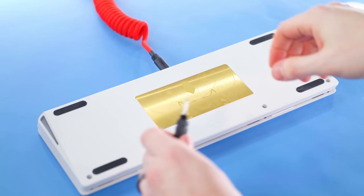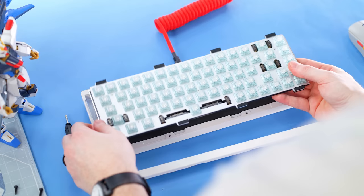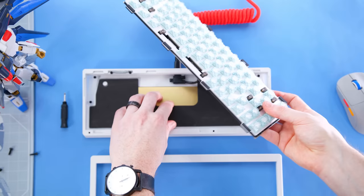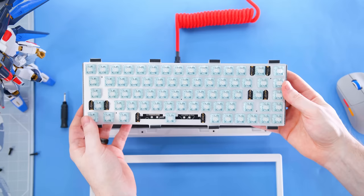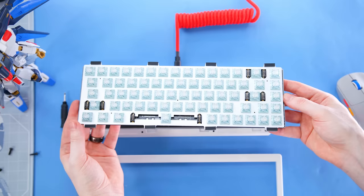This is by far the easiest and most mod-accessible keyboard I've ever seen, because typically there are bottom screws and screws in the top plate to hold it down — but Highground's got it figured out here. Once the top frame is removed, the plate and PCB can be lifted up, and you'll see it's gasket-mounted with rubber strips around the outside of the PCB. This is what gets sandwiched between the frame and board to give it that free-floating design. There's also a layer of silicone sandwiched between the PCB and the top aluminum frame, and a foam dampening layer on the bottom to help absorb micro-reverberations and give it a deeper sound — although this foam strip is very, very thin, so I'd argue it's not doing too much.